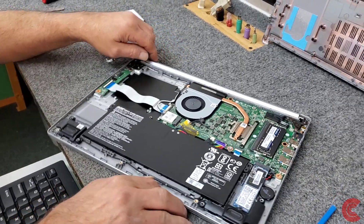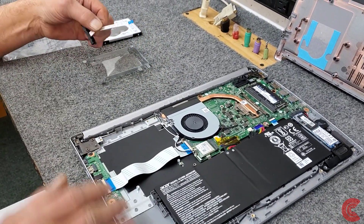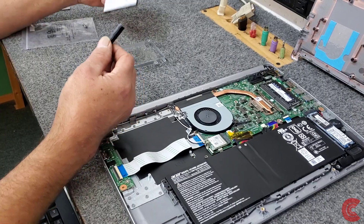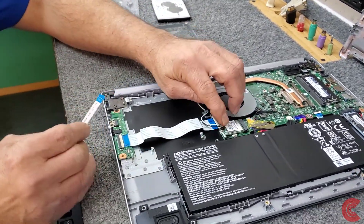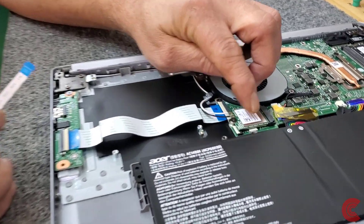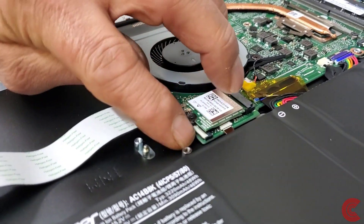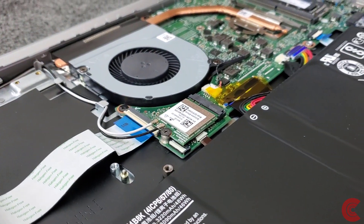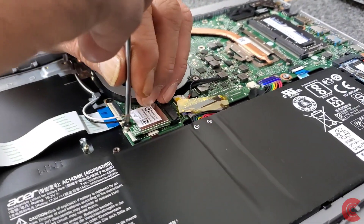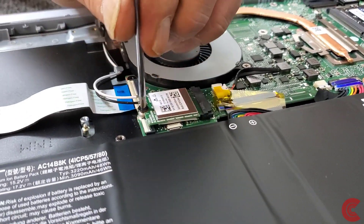Let me show you what we've got to do here. This little SATA connector is going to go on the hard drive, but it plugs into the motherboard right underneath the front of the Wi-Fi card here. It doesn't flip up quite far enough, so we've got to remove the Wi-Fi card first — just one screw. Be very careful getting it out.